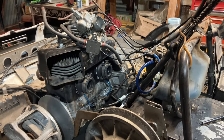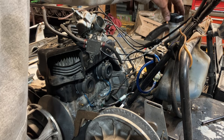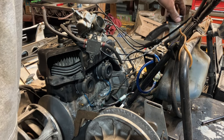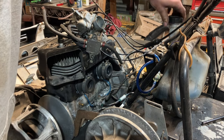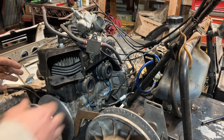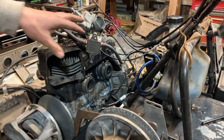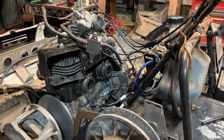And then I was gonna go through the carburetors just to see what's inside of them. We checked the pickup line in the tank, that was all good. Put a little bit of oil in the injection bottle to see if we can bleed the pump out later. Mark fixed the wiring that was melted on the exhaust side, loomed that all up nicely, and then we just got to tighten the motor down once we get the clutch alignment happy. And like I said, just set the carbs in. We might be able to hear it run today.